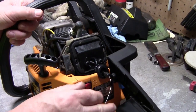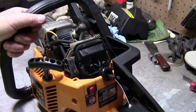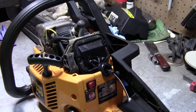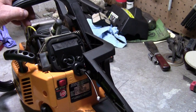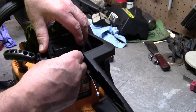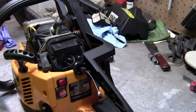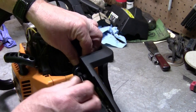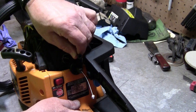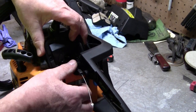With this cover off, I should be able to move it over a little bit, get these screws out, and get the carburetor off. Now I'm going to take these two bolts right here out — they take a T25 Torx bit. Just one screw at a time; move this over and pull the other screw out. They're pretty long. Take this cover right here off.